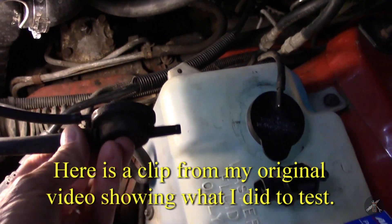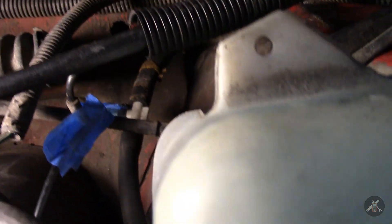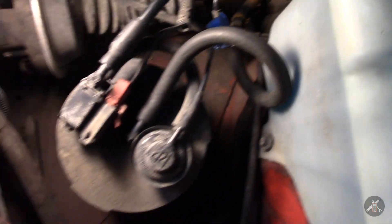I haven't really scienced out the carbureted setups on the Camaros, so you need to look at your service manual for the application you're working on. I'm going to mostly talk about tuned port, but things are related. If you have a throttle body injected or a port-injected V6, principles are similar. There's a purge valve that goes in the plumbing down here — you can see down where that white T is. I put my vacuum gauge on it along with a vacuum source and tested it.